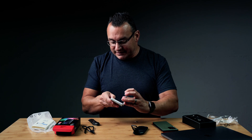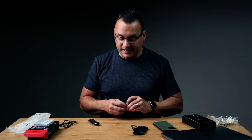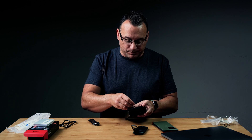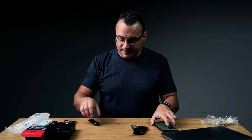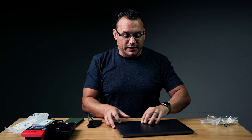We're going to plug it into the Mac and do a speed test. The reason I'm doing this on a Mac is simply because I want to use the BlackMagic speed test tool, and I'll primarily be using this on a Mac. I always format my drives so they'll work cross-platform, so when I format this drive I will be formatting it as exFAT so it will work on both Mac and PC, not Mac OS Extended Journaled.